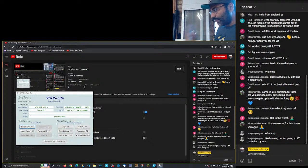So VCDS, when you log into it, again, look it up online. There's a couple of videos. I will do some research myself and figure it out on my own so I can show you guys how to do it. You can unlock the ABS module. You can open all four pistons inside that ABS module and bleed the system completely, which will allow you to properly purge your brake system and give your car like brand new braking. It's insane what happens when you put fresh fluid in your brake system, just FYI.